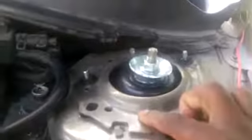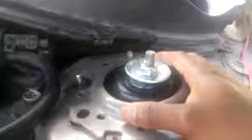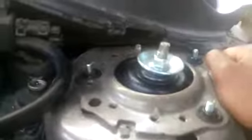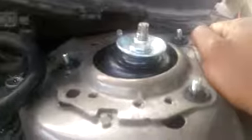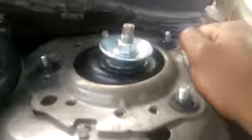As you can see here, I drilled out the spot welds — this whole piece is able to be moved. So I was able to get everything in spec. I tightened everything down and everything so far so good. It tracks perfectly. No wear on the inside tire.